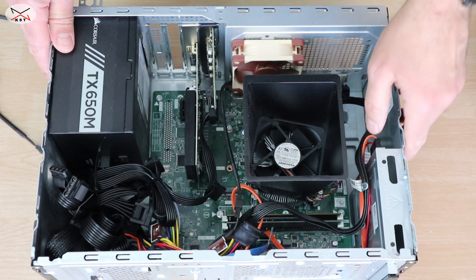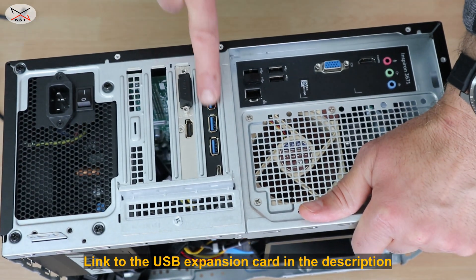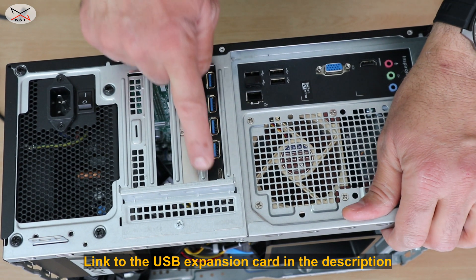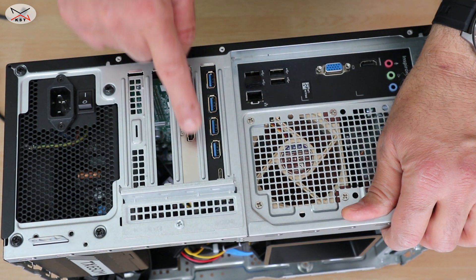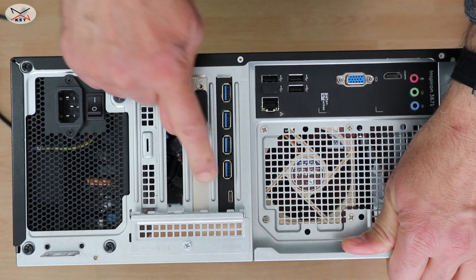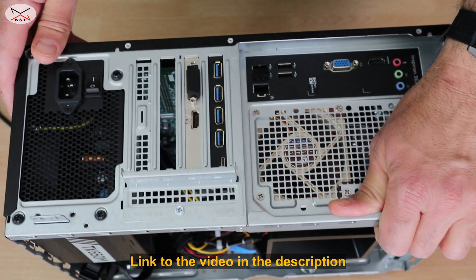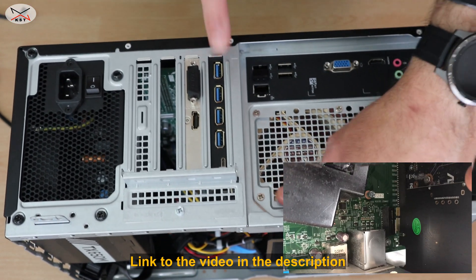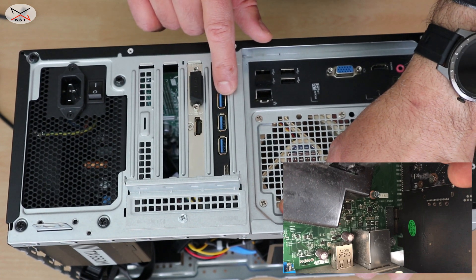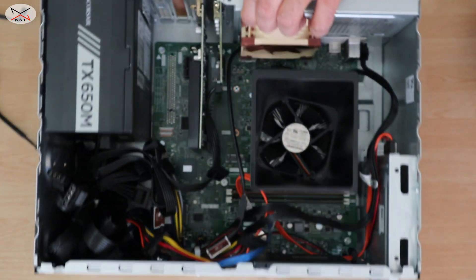So let me show you the USB expansion card that I added earlier, the one that I mentioned in the introduction of this video. So this is it here. As you notice it has four USB 3.0 ports and it also has a USB-C port. The link for that video is in the description if you want to see how to install it — it's pretty easy. It's just a PCI card; you put it in the PCI expansion slot in your PC and you power it with the SATA cable.